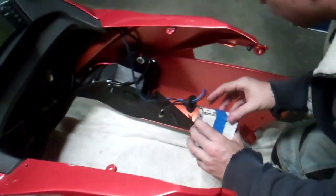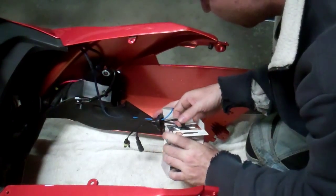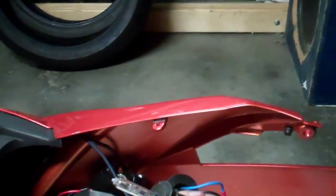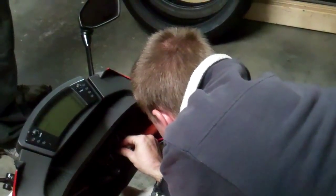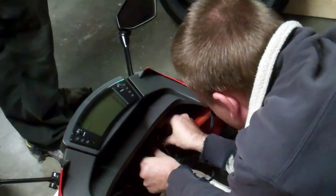Now for the rest of the parts - I have my actual bulb right here. This has 12 volts going through a filament, which heats up and glows a yellowish-white-red color. This HID has about 23,000 volts going through it, arcing across xenon gas, which causes it to emit photons. Fold the wire over, attach it, and the bulb is installed. There's the ballast, there's the igniter, bulb is installed, there's the wires.